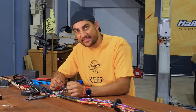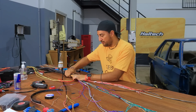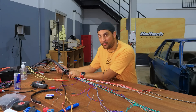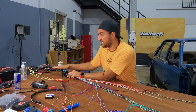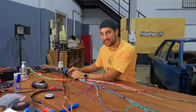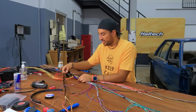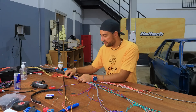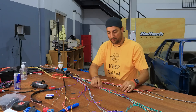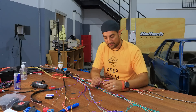We've got our loom broken down, covered, and insulated back to the interior. The grommet is going to be in this rough area - I've put a red tape on there like I said I would. We're going to ignore the ignition coils for a second and throw some braid over the coolant temp and the breakouts that we've already somewhat prepared.